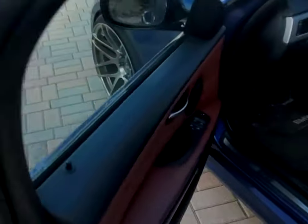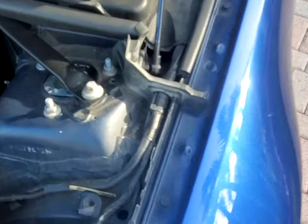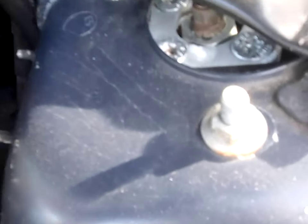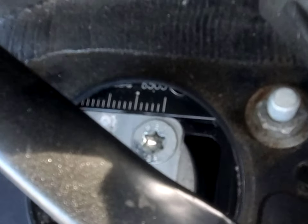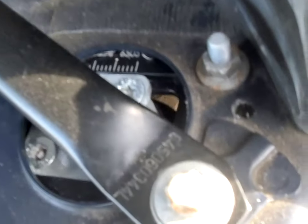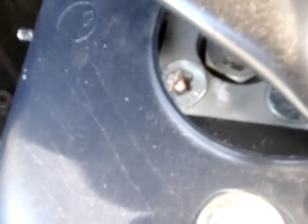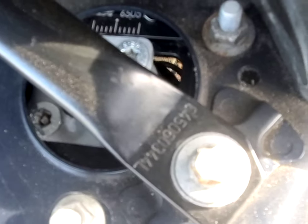Let me pull the hood up a little bit so you guys can see. Now just to show you guys how much camber I have — you can barely see it from there. I could go in about maybe half an inch more. All I would need to do is take this off, loosen these up, and then push the whole suspension over a little bit, and it should be able to tuck in even more.